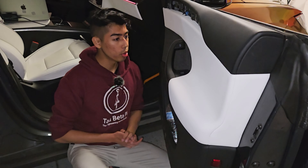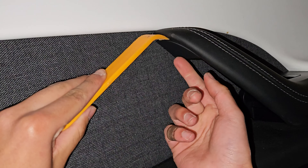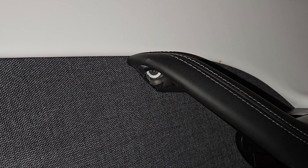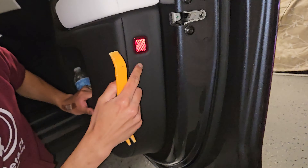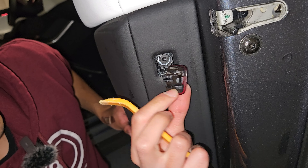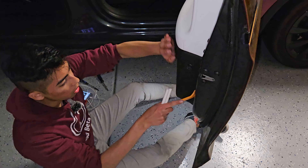Now it's time to remove the door. We need to remove four screws — start with the one underneath your door open button. There's a little panel back here; use a plastic pry tool, put it in and pop it out, revealing a screw. Remove that screw — it's a T20. Then remove this clip, which is easier to just pop out. Next is the reflector on the back — take your tool and pop it out. It does say 'this way up,' so pay attention to that when you put it back in. Then remove one more screw up here.